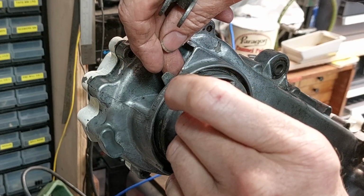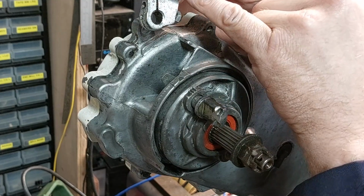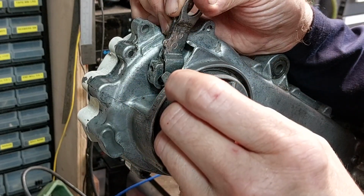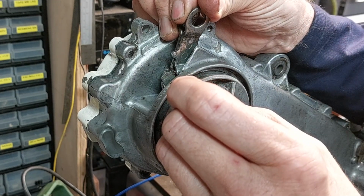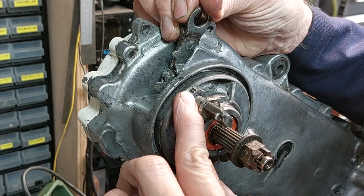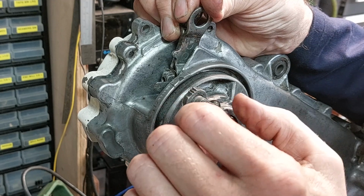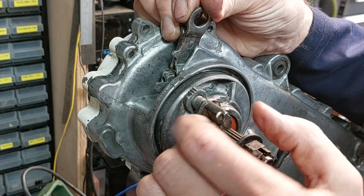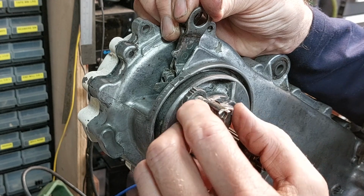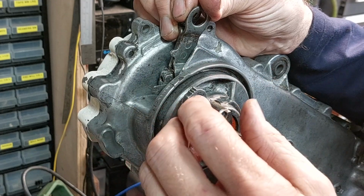There's not a lot of room in there. And then this, you've got a lining mark here, lines with the front edge of the brake lever here to go on. Okay, right, so that needs to be about there, but what you do is you line this mark up. When the shoes are new, it's this mark here, and then as the shoes wear, you can take the shaft off, move it round one spline to the middle spline, and then you've got another allowance of movement to a third spline, and then when the wear indicator gets to there, then the shoes have had it.